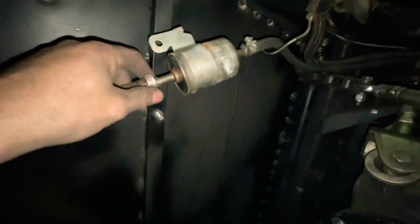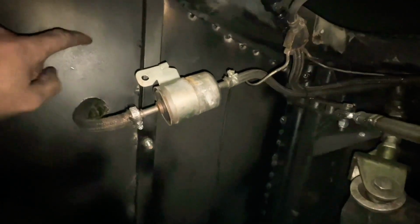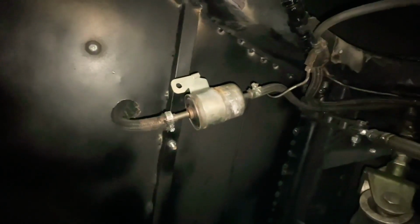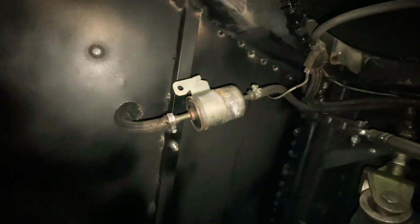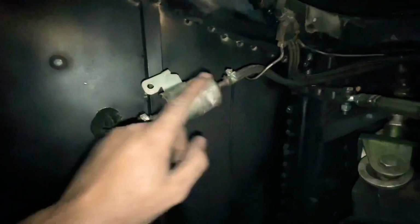And the reason I filter this is that way, if this line right here ever corrodes or starts coming apart, it won't dump all that rubber back into my fuel cell. So I'm the person in control of the junk in the fuel cell. If I use a decent funnel and I filter it and make sure everything ain't getting in here, then I don't have to worry so much about the pump. And I also make sure I'm not getting contamination from this raggedy line coming back to it, that it don't pick up no chunks of rubber. If anything gets past from here, it don't get washed back into the fuel cell. It'll help the pump. Anyways, I'm gonna dump some fuel in and see if I can fire this thing off